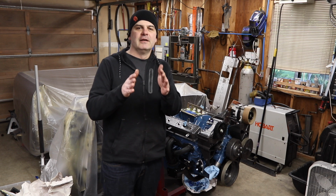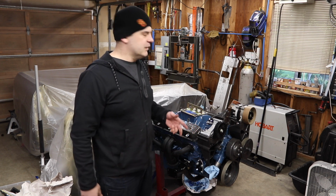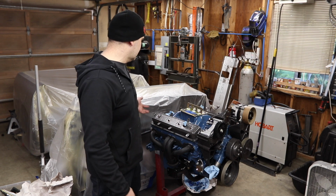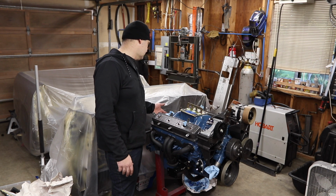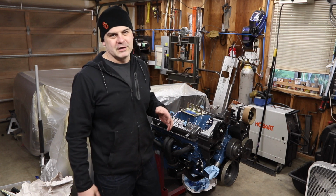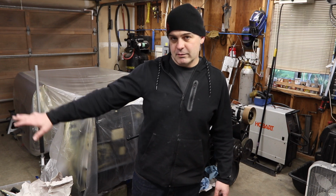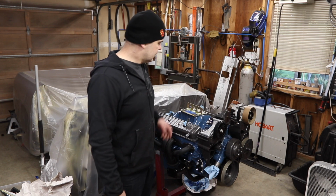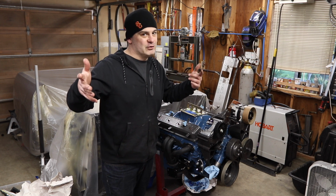Somebody said that you can run it on the engine stand. I'm not gonna do all that. You gotta have the flywheel and the starter motor. I don't even have the flywheel on the back of this thing, and you can't get it on once the engine's on there. And plus, it just doesn't sound like the safest thing in the world to me. So we'll get it into the frame, nice and safe. I'll support the back, and then we're on to the transmission rebuild.